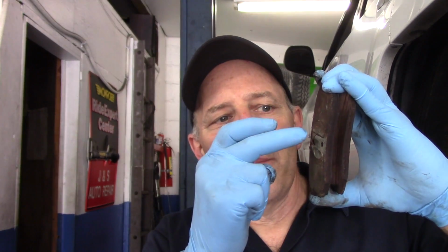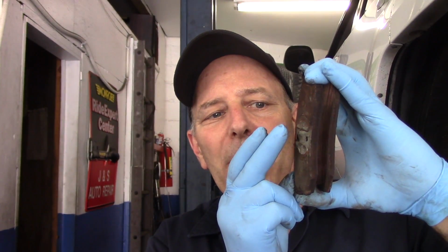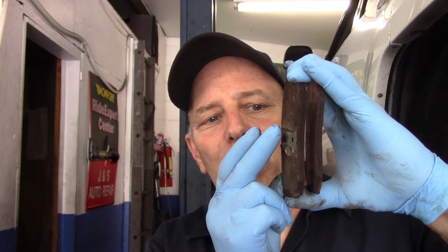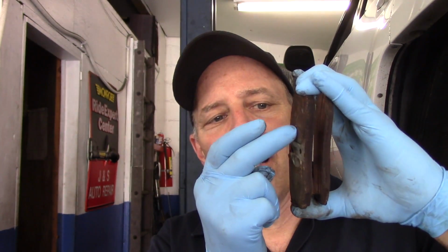Because what happens is you have your new brake pads inside here, such as this. The piston has to touch in the back over here, but the piston, remember, you pushed it back in, it's all the way back here. So when you step on the brake pedal, it pushes that piston back out, it comes in contact with the brake pad, and then it squeezes it together so it's a nice tight fit on there. So it is normal for the brake pedal to go to the floor for probably 3, 4, 5 times, and then you'll notice the pedal is up on top.